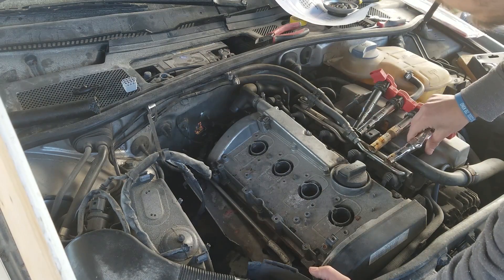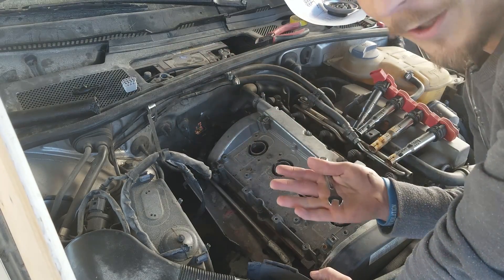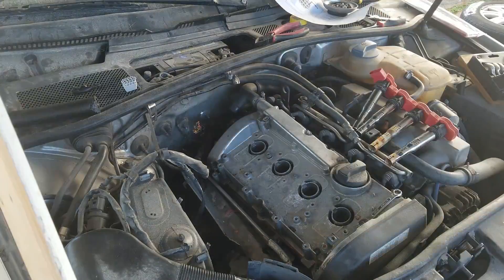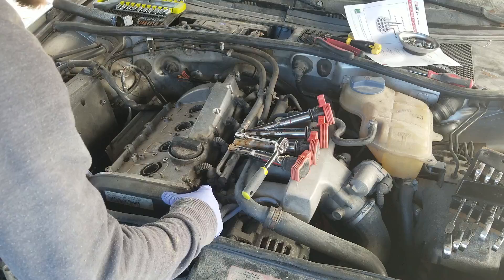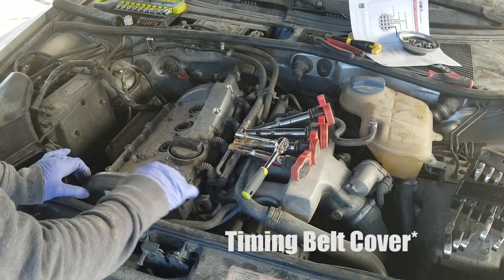To start, I've just removed my coils. My son's playing with his toy lawnmower so you're gonna hear that in the background. I removed my coils and I'm gonna go around and remove all these screws. You've got three down here through the middle and then they're all the way around the perimeter of the valve cover. With all the screws removed you're gonna pop these clips off of your timing case cover.